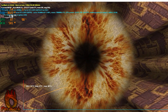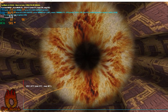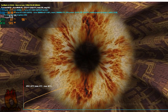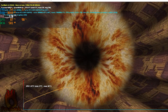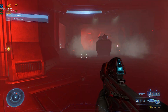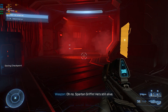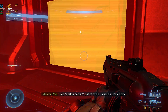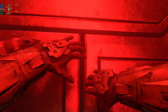With no fans installed, the graphics card quickly reached a maximum temperature of 88 degrees Celsius and a minimum temperature of 37 degrees Celsius. However, this is with a synthetic benchmark designed to heat up the graphics card. What about a video game? And what better choice than the newly released Halo Infinite? In this game, the temperature quickly started to rise and stabilized at 83 degrees Celsius, with the same 20 degrees Celsius ambient temperature.